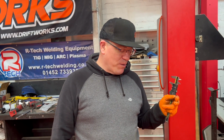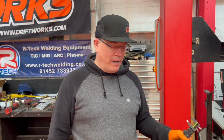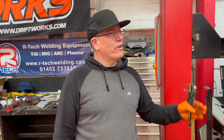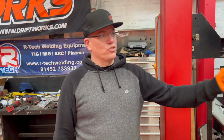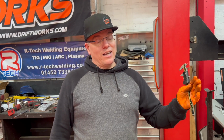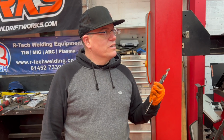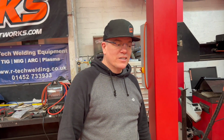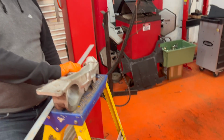I know a lot of you are probably pissing yourselves laughing because we're talking about 7.5 mil here, the difference. But that is all that it takes. 7.5 mil extra track width on the lower arm means that exactly the same camber as I had before, which is 3 degrees when I was having the handling issues. The wheel's 7.5 mil further out at the top, which means it's going to pile into the arch. So yeah, I'm going to have to do some more thinking. Damn it. Not a good plan, not a fun plan.